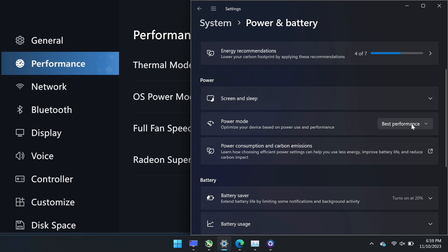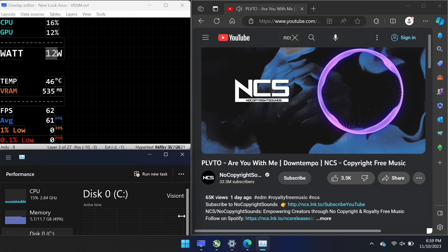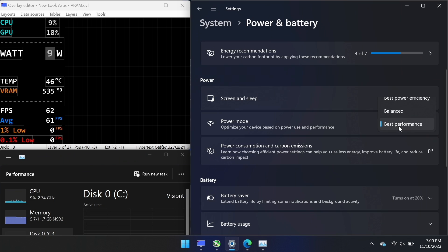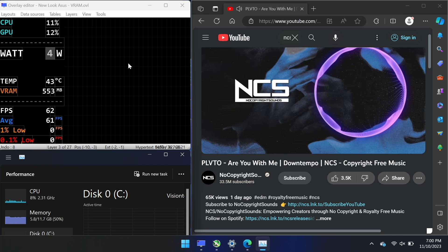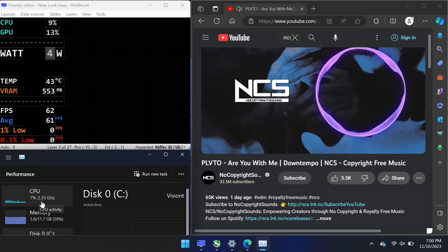Here's why you might not want to run best performance. We have a video playing, and you can see the watt usage is at about 12-13 watts — it should go down to about nine. In task manager, we're at about 2.8-3 gigahertz for the CPU. Now we're going to open up those power settings and drop it down to best power efficiency — and you will see it just dropped from nine down to five, four watts. While watching YouTube, we're maintaining about four watts. That is a massive battery savings, and that is the main reason you would want to use efficiency — it lowers the CPU clock and pulls wattage specifically from the CPU.